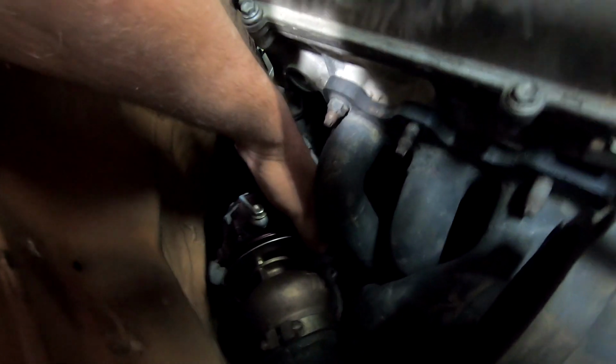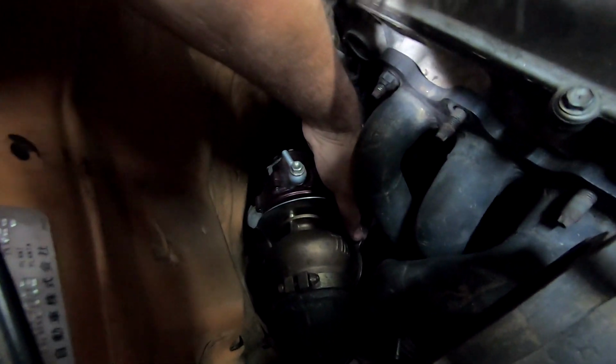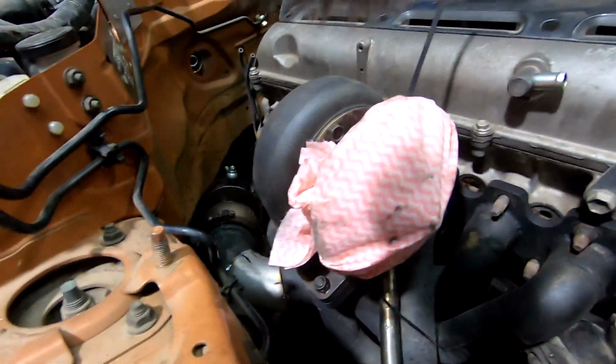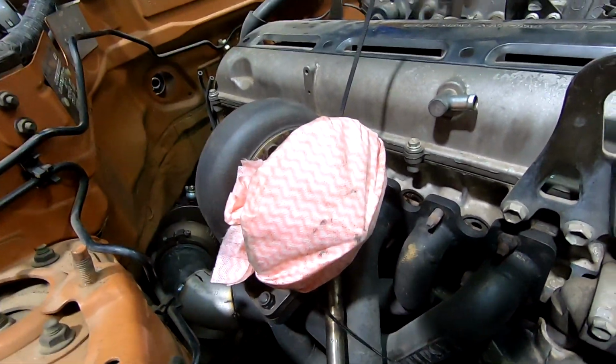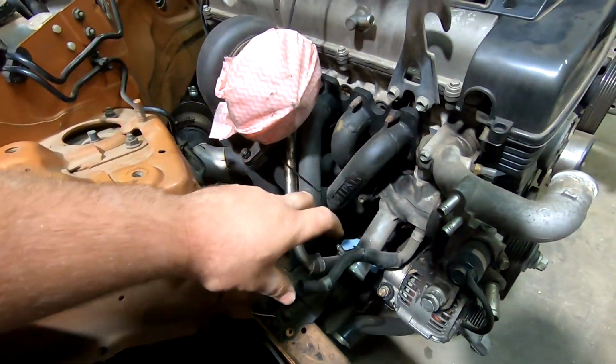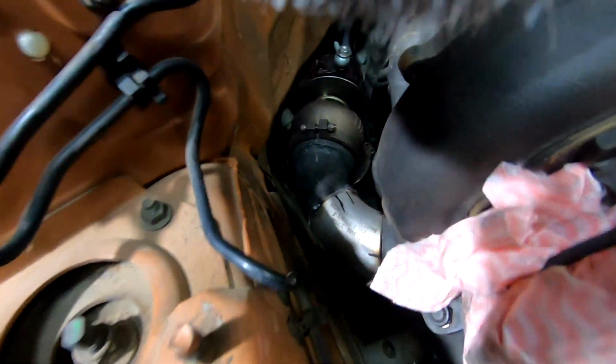And then the screamer has got to come off of the wastegate down the bottom after, and that's going to go around the steering shaft, which is down there as well, and then around and straight down to the ground. So that's where we're at the moment. I haven't done anything with the actual front housing. I've got to modify that to clear through here and then come out through there to the intercooler and that. So yeah, I'm going to get to welding this up.